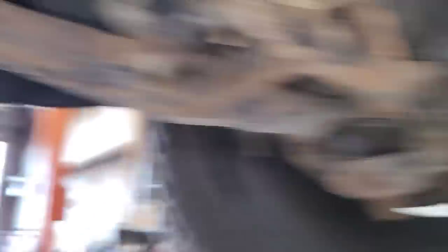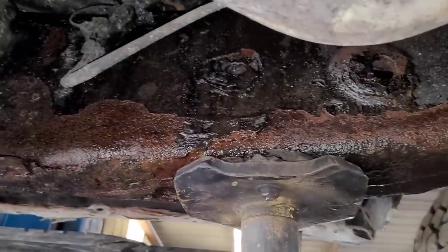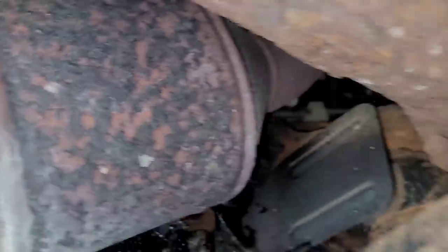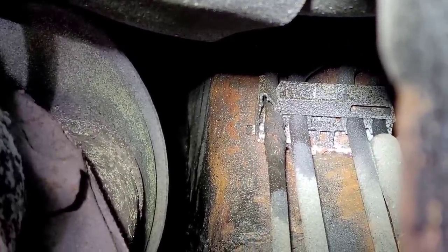There's the front brakes — I don't see anything wrong in there. But if you look, those rotors and backing plates are pretty well rusted up. This one's far worse than the other side. Let me let this thing down and re-check from underneath the hood or look from inside the wheel well area. I'm up under the hood — take a look carefully. The master is all clean, but if you follow the brake lines on top of the frame, you can see it's all wet on top there. That larger line — I've got a funny feeling that's leaking.